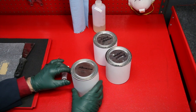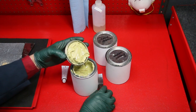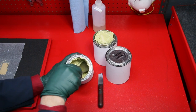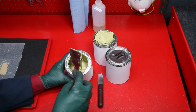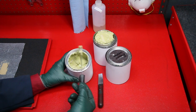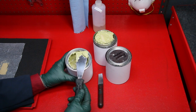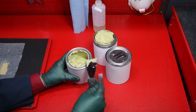This is the premium, or what I call the final finish filler. Notice when you let it sit it starts to separate, so mixing is always important. Look at how smooth and runny it is. If filler gets too old it can get hard and lumpy and difficult to work with, so I don't recommend using really old filler. This is a premium grade filler — I recommend you don't skimp on the cheapest filler out there, because the sanding characteristics and how it plugs the sandpaper will not pay off for you.